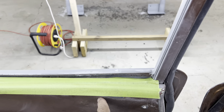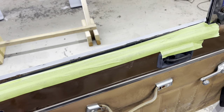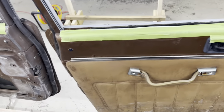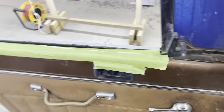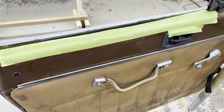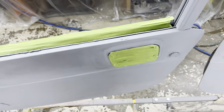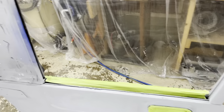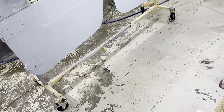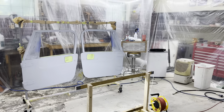I still have to prep the other side of the doors — I've got a little bit of work to do on them. The passenger side has a dent right here, probably where someone kicked it trying to get the door open. I've got to either take off or tape off this trim piece — it's going to get cleaned and painted with a vinyl black paint. I'm not going to replace the seals and channel glass right away, but maybe the door seals around where it shuts — that's simple enough to do. Tomorrow morning, bright and early, I'll be out here painting. Hopefully it goes well.